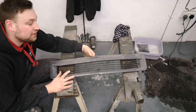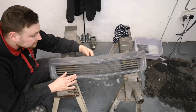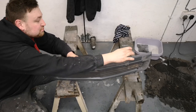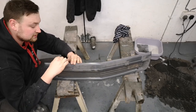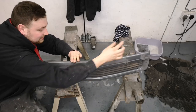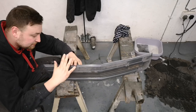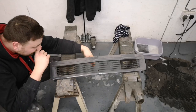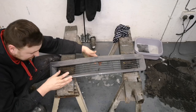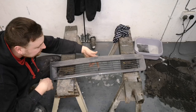Now I'm moving on to something a little bit more fiddly: the grill. Vauxhall lovers will know these are GTE SR grills — they're very delicate. They've got three plastic brackets across the top and they always break. They should have had a little insert in them really, but they never did. So that's the first problem — I've just got to be careful. Secondly, the paint is coming off everywhere, so it's going to need a good sand down. It never really stuck to it very well in the first place.